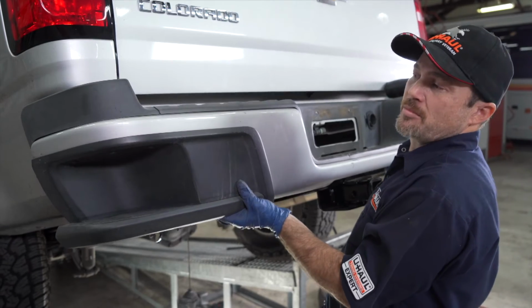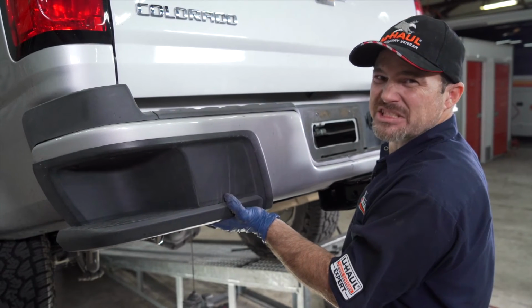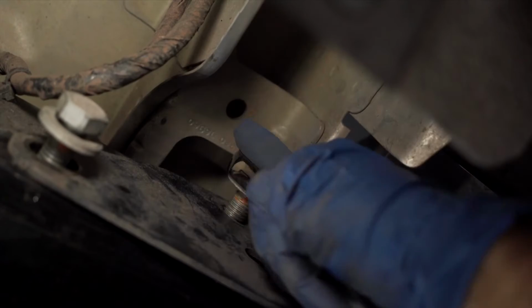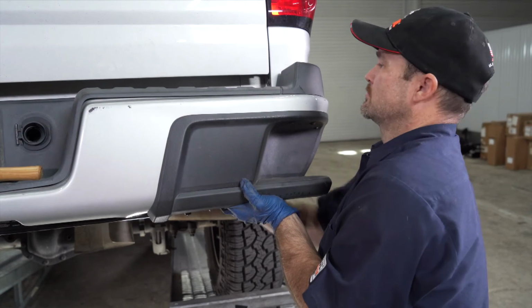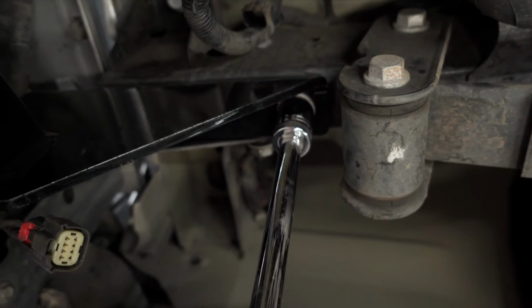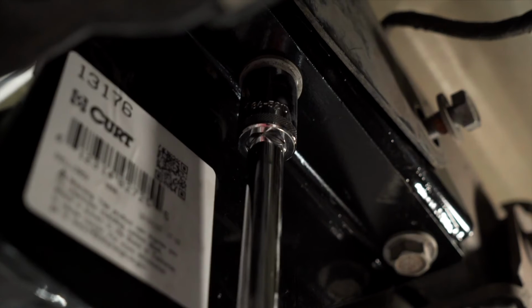You will notice the bumper has some play. We're going to want to lift up on it just a slight bit as we tighten it down to keep it nice and centered on the vehicle. So you'll want to lift up while you tighten it down so that it will stay in place for the rest of the bolts. We can now tighten and torque our hardware to manufacturer's specifications, which I will link in the description below. Repeat on the passenger side.